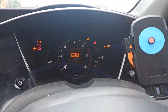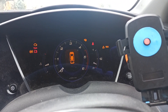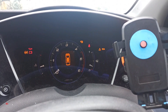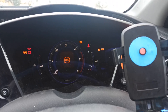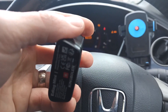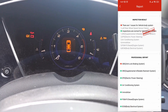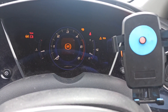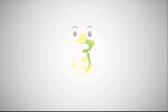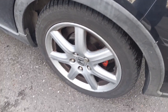Hello everyone, welcome to FROGTECH Tips. Today I will show you how to remove the ABS and VSA sensor. As you can see, I have these two warning lights on. I already used my diagnostic tool — I'll show you how it works in another video — which showed me it's a left rear ABS sensor fault, and the sensor is on this wheel.